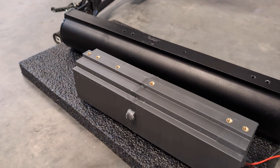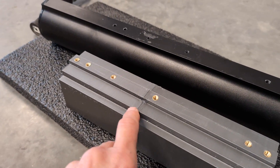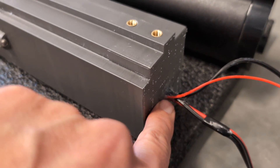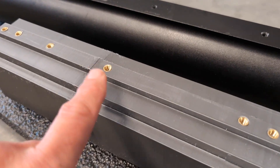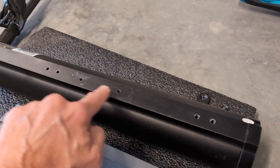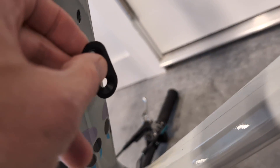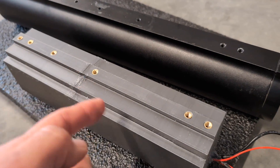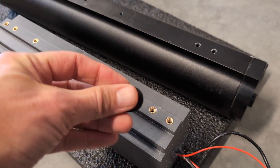The battery is now complete. I slid it into the case and sealed the seams with silicone adhesive, ran silicone around the edges for waterproofing, and siliconed where the wires exit, so this thing is essentially waterproof now. It's going to mount into the frame using the same mounting holes as the factory battery. The factory holes are M6 bolts, and the water bottle holes are M5 — I just used M5s for all of them since that's what I had, but you can use whatever size screws you want.